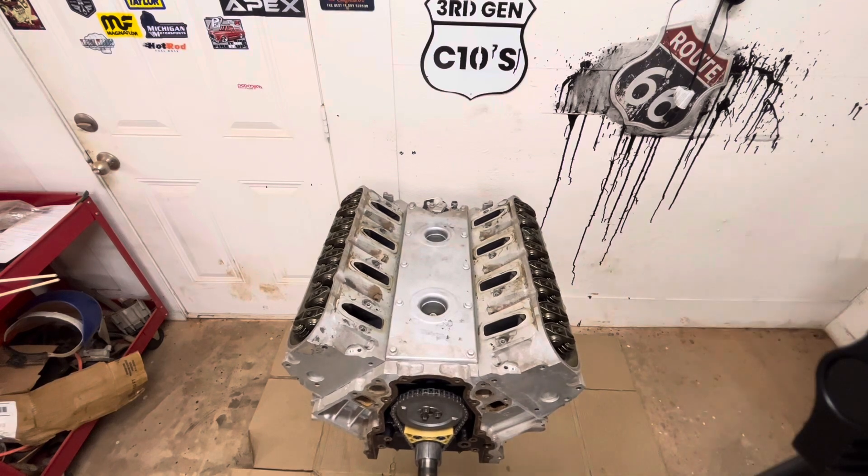And that's all there is to it — tightening the rocker arms in the correct torque sequence. That way your torque reading is accurate. All of them are off low lift this way, so you're not getting a higher or lower reading than you should be — you're getting the correct reading. They all are at 22 foot-pounds. If you liked the video guys, like, comment, subscribe. We'll catch you on the next one.